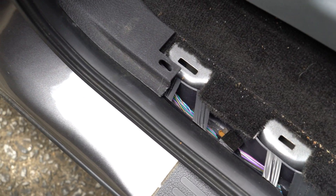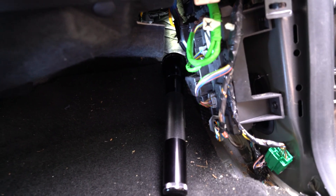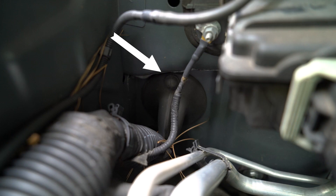Now we have access to the dashboard and the wire chase. There's just enough room for us to work. Rather than drill a hole in the floor for cable access to the engine bay, we are going through a big rubber grommet supplied by the factory. It's located on the firewall behind the dash. Here it is from the engine side. Only the positive red wire will need to go through this.